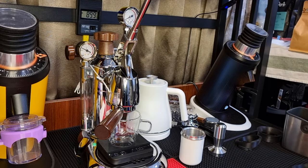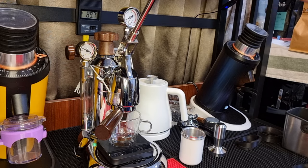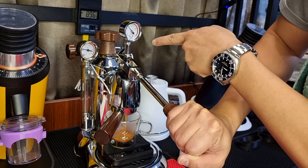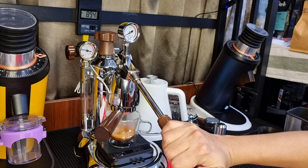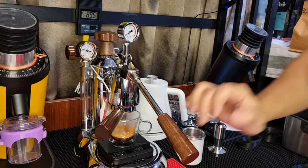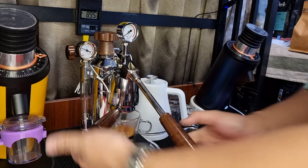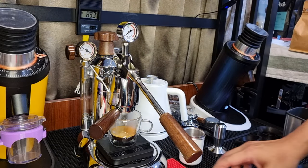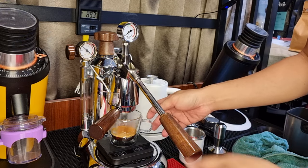Observe the pressure gauge — it actually goes up slightly to about one bar and I'll be waiting for the first drop. I can see the first drop there and I'm just going to pull down. Oh, it's leaking out. So probably my gasket is not installed properly — I'm going to check that out. Or maybe my portafilter didn't engage fully. So I'm going to wipe it down. This sort of thing can happen because I've just recently installed the new pressure profiling kit and I'm still in the testing phase.